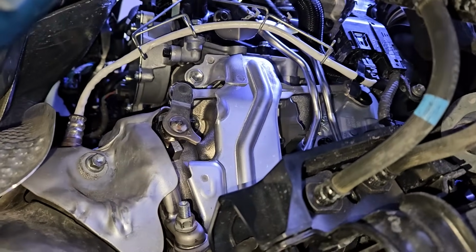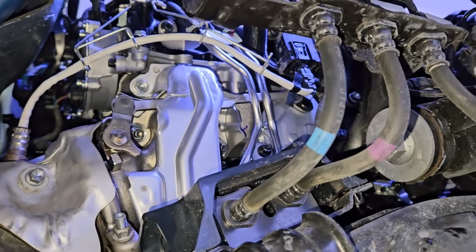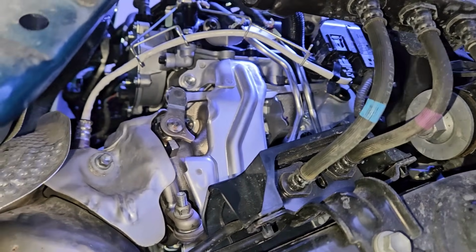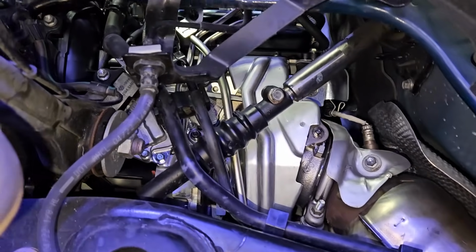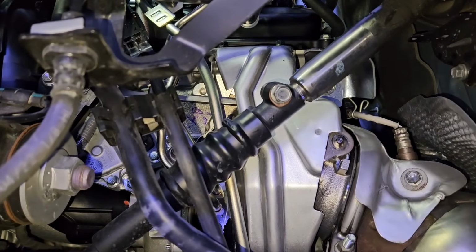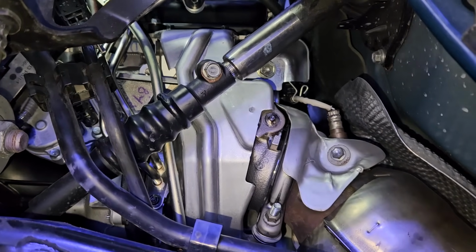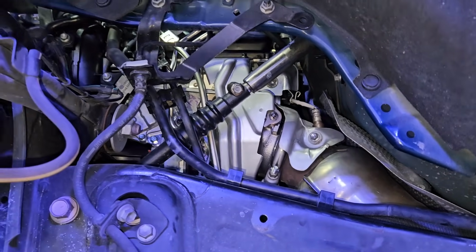As you guys can see, new clamps are provided. I have my air fuel ratio sensors connected, wired up properly. I got my heat shields back on. So everything's looking good, guys. Again, through that wheel housing liner cover, it's crucial you have that thing removed. So everything looks good, nice and shiny. I'm sure this customer will be satisfied and happy with the repair and the engine replacement.